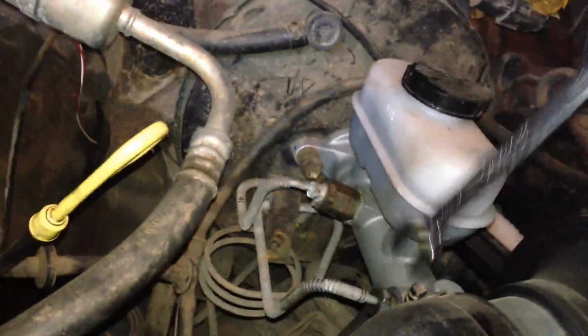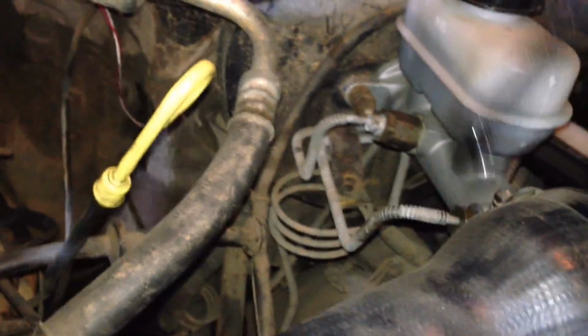And you come back over here. That builds up the pressure. Come break that loose, you'll see some squirting out. That's exactly what you want. Had some squirtage. I'm going to tighten it back up. Sometimes you can just do one. You can do both. Just keep repeating this process till you feel like your brake steadily climbs up, becomes more stiff. Instantly my brake is a lot stiffer. So I'm going to push it back down.